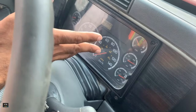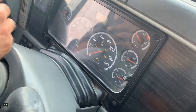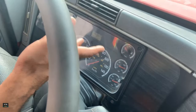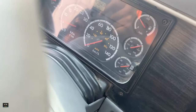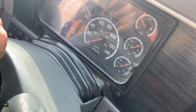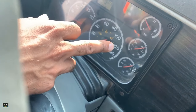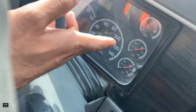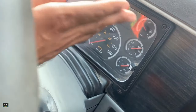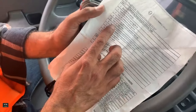Since I found the cutout, I need to find the cut-in. The cut-in is usually 20 to 25 PSI below the cutout, but make sure it happens before 80 PSI. My cutout is 125, so subtract 25 — that should be 100. I bring it down to 100 and check to see if the needle builds up. The pressure is building at 100, which is good because it's above 80 PSI. Cut-in on this truck is 100.